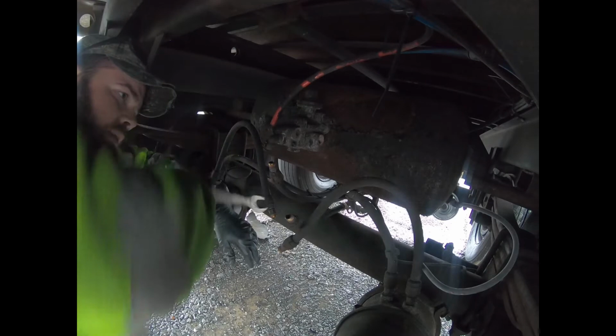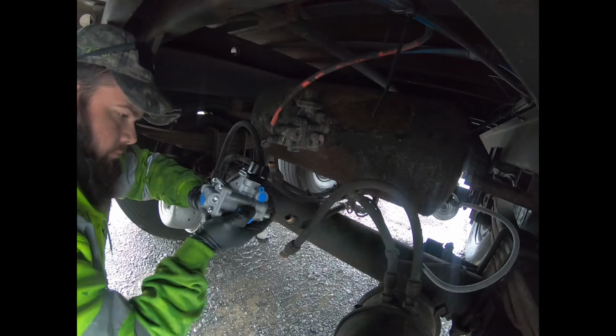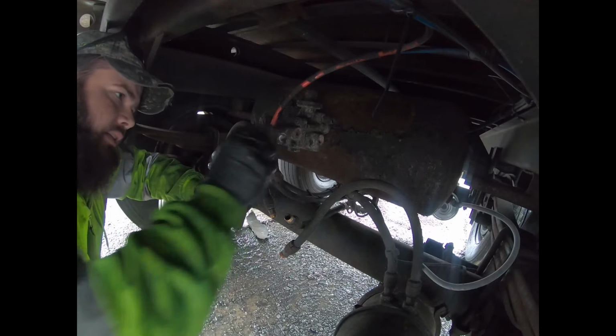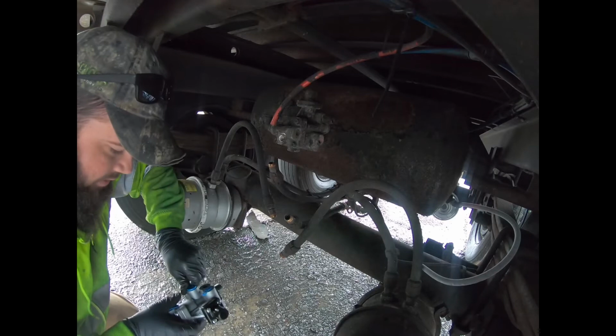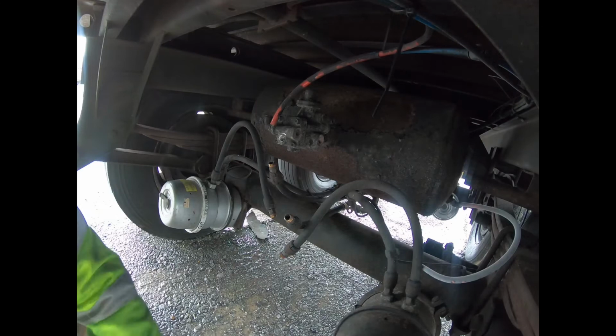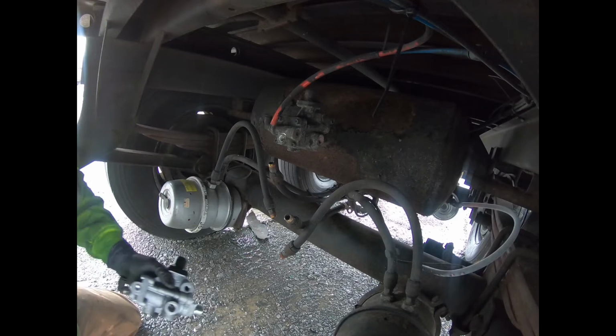And what I like to do is pre-thread them in the new valve just to avoid the accidental confusion of mixing them up. As I pull them out, I just start them in my valve so I don't accidentally mix placement up. If you get different sizes, it happens. I've done it more than once. And we will have to exchange a quarter inch pipe nipple, it looks like, for a block off. So there's one.